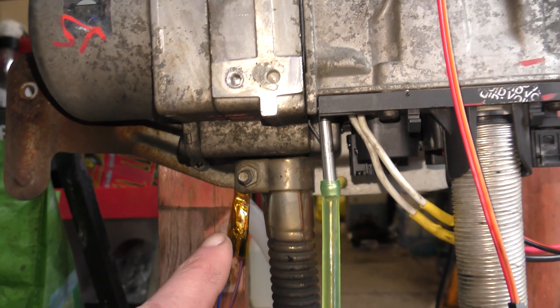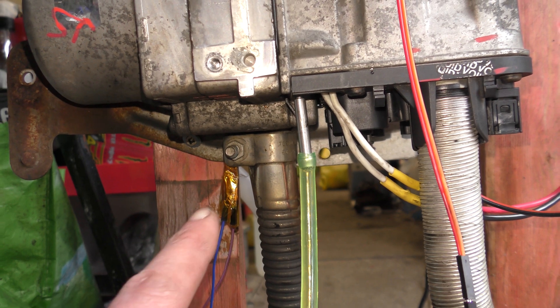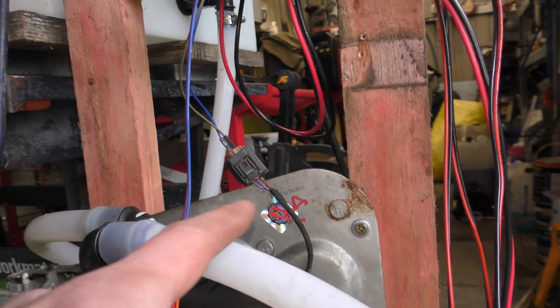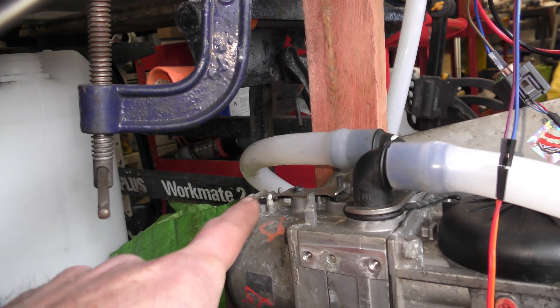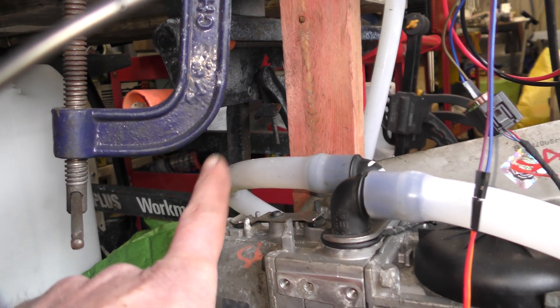This little sensor poked in here is our current exhaust temperature sensor. This will change very soon as we've ordered a newer, higher temperature sensor. It takes the water temperature readings from the original temperature sensor in the Webasto, which is one of these two — I think it's that one. That one's an overheat sensor that we're not using yet.